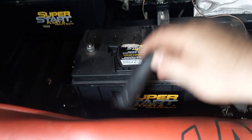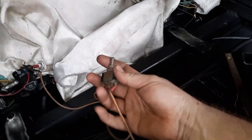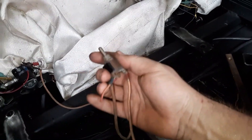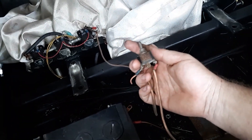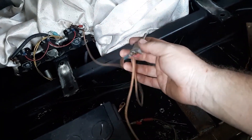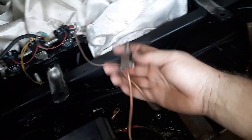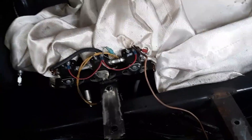So what we're going to do here - I got my ground, got my little test switch here. I rigged this thing up years and years ago. It's been pretty much invaluable. It's just a handy little thing to have in the trunk - you can jump wires, you don't have to worry about a live wire sitting around. Got me some little alligator clips on it. I'm going to connect it to the battery, connect it to whatever I need to - if I need to connect it to the top of the solenoid or to a wire. It's easy, don't have to worry about it falling off.